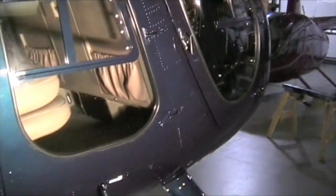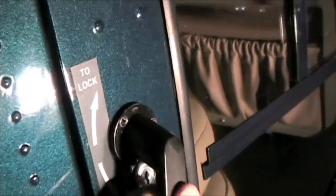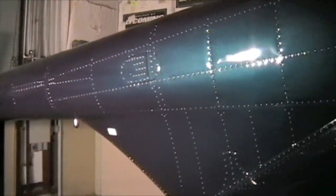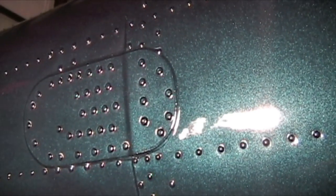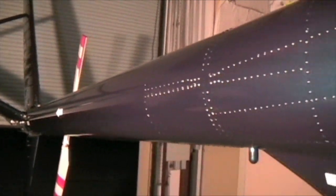Done with the front door area — we're going to move to the back. Open this door; push down and open her up. We've already checked the attachment point for the back right door. There's a nice handle you can grab when you're trying to get up into this thing. Here's your sight glass for the main rotor gearbox transmission fluid. Walking down the right side of the tail boom, checking all the rivets. Make sure all the inspection panels are secure — this is a patch. Make sure all the rivets aren't coming out of the patch. There's no damage at all allowed on this tail boom — otherwise it needs to get replaced or inspected.